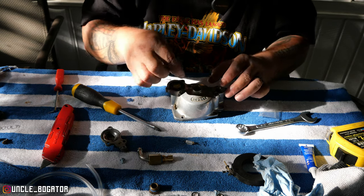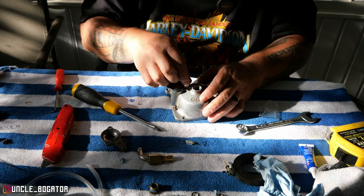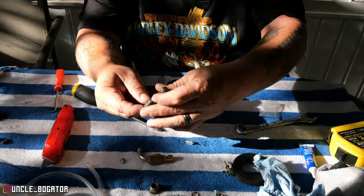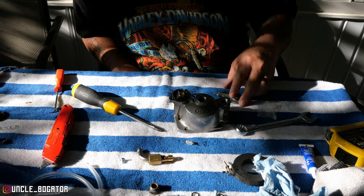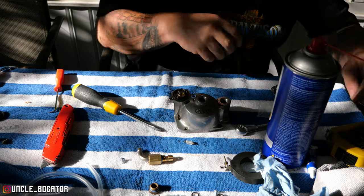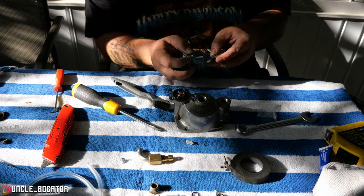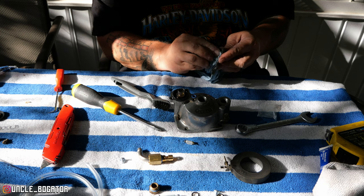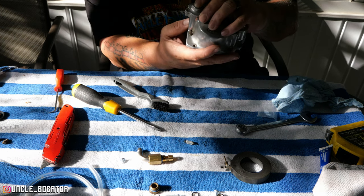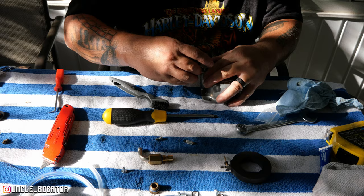This one has a spring. I'm going to put these o-rings in first. This can get pinched pretty easy — you want the lip facing up. I should have cleaned this part first. The sun is really bothering us both, I know the lighting isn't ideal. Let me spray it over here to the side. It's been years since this thing has been given any love. I want to make sure the areas around these check valves with the ball bearings are especially clean — I don't want any gaps there. Just wiggle it a little bit and it looks like it's in there pretty good.